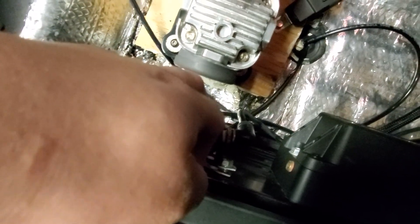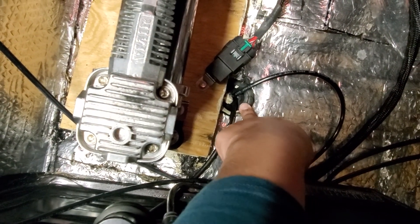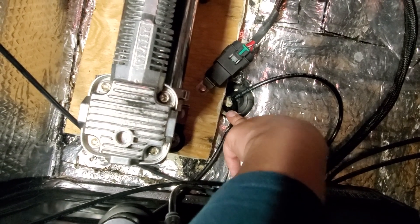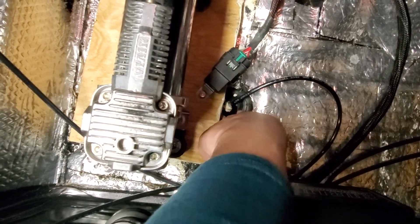This is your management, which controls the air to each bag. As you can see there are lines coming out. This is your water trap that self-traps the water that comes out of the tank. I made it drain out through this little spare tire area through a grommet. This other line comes from the management straight out of the vehicle.